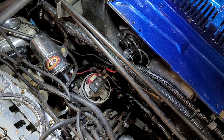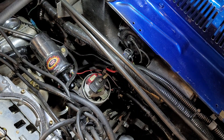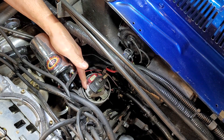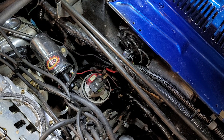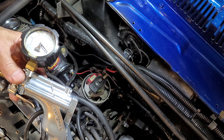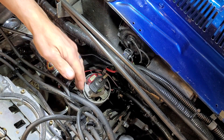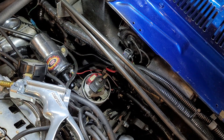When you pull vacuum using your gauge — when you operate your little vacuum tester — at some point you should see some movement out of the advance mechanism of your distributor. If you get up to around 15 to 20 inches of vacuum and you see no movement whatsoever inside of here, that means your diaphragm is probably not functioning properly, has a severe leak, or needs to be replaced altogether.